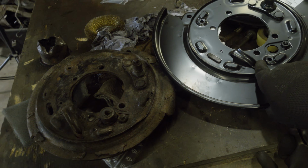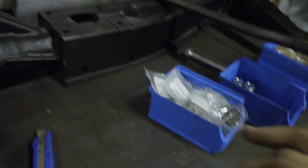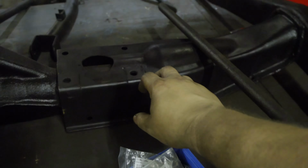Since nothing is more continuous than changes, I changed my plan. I've used different bolts I had, which fit properly, secured in with self-locking nuts. So everything here is fine and dandy. So of course I had two nuts to spare, which helped me mount this brace, which is now tight. I put the diff T-bar supporting frame down on the table too. Then noticed I need a load of brackets I didn't have cleaned, sanded, painted yet. So I did. These already are clean and have three coats of rust converter, rust sealer.